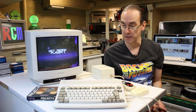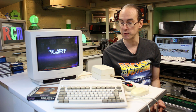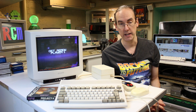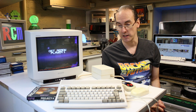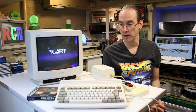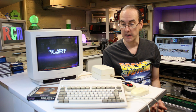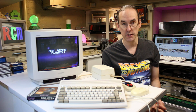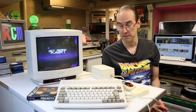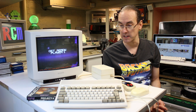I've still got to obviously think about the capacitor change in the near future. I've done some research and come across two other YouTube channels, RMC Retro Man Cave, and Jan Beta. Both very interesting channels actually, worth taking a look. They've both covered the capacitor change on the Amiga 600 and shown in great detail what to do and what not to do. And it didn't occur to me about removing the ribbon connector on the back there near those two surface mount capacitors, because I thought to myself, how are you supposed to get to those? I never really thought about taking off the connector, so that's really good advice there.